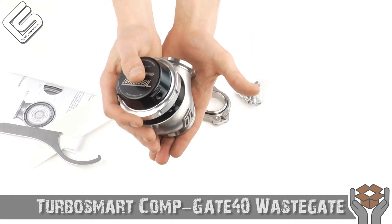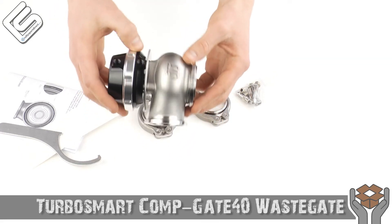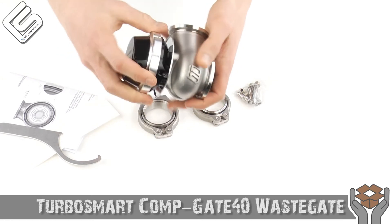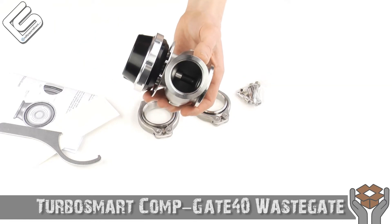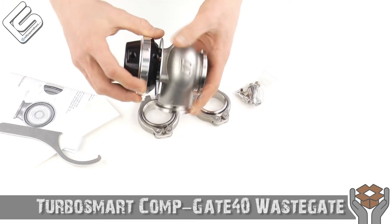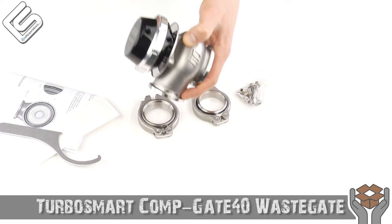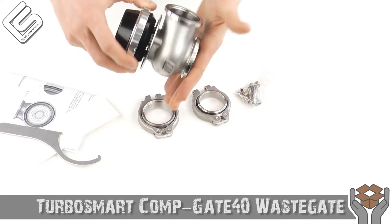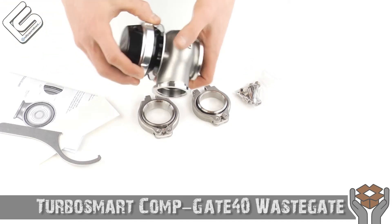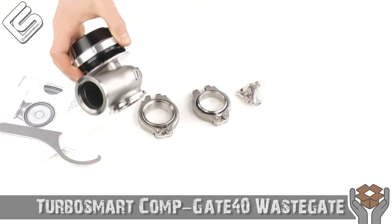You may notice I do not have huge hands — this is actually just a very small wastegate, and that is the whole point. They wanted to make it great for people doing builds with not very much room to work with, while still giving extremely high performance out of a very small package. Being able to rotate this in 12 different positions gives you more options for routing your boost and vacuum lines exactly where you need them, making installation much easier.